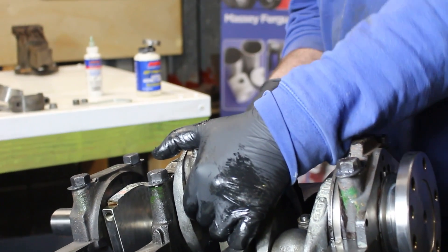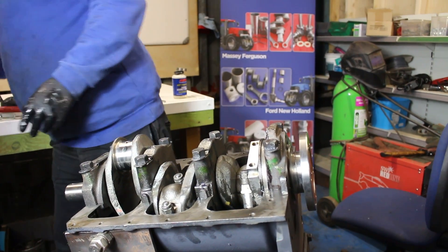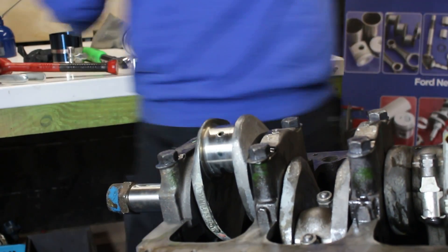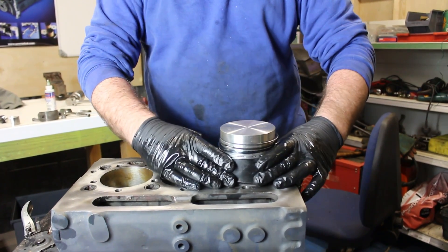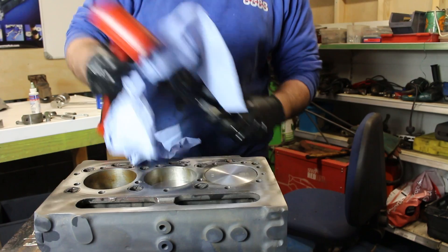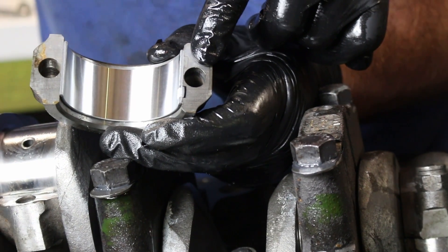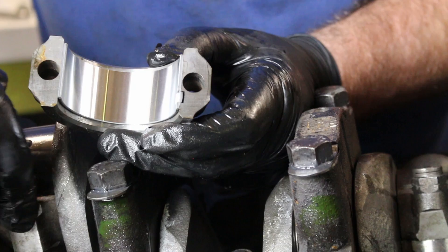Remember to get our shell for the next one, a bit of lube, remember the numbers and face them towards us, then give it a gentle tap. Once you get started you can just give it another little nip. There it is — that one's in. Make sure we get the right cap — number two. Same thing again, get a socket, make sure our bolts are all the way home. I'll put the crank bolt in to make it easier. Then for number one another shell — if you can see where the little notch is, above it you'll also see a little witness mark of where the bottom one was sitting.